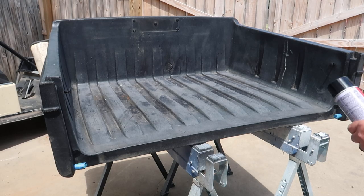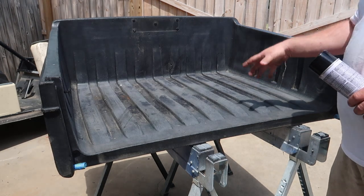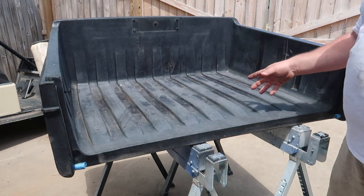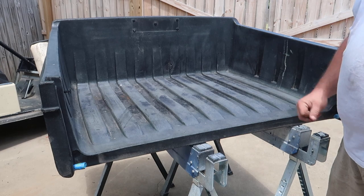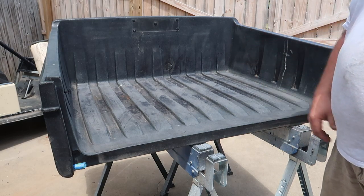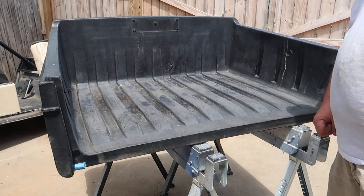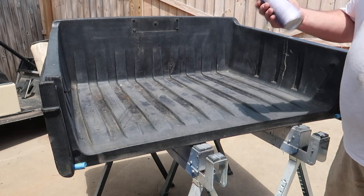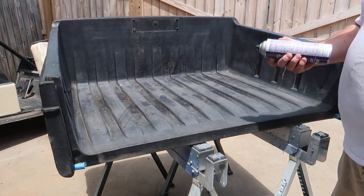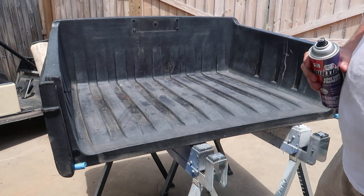So they're calling for rain today in about 3.5-4 hours. We're gonna paint this outside, or Raptor it outside. I've removed the golf cart from the shed and put it in the garage. So after this dries for, let's say, an hour or so, we're gonna drag everything into the shed and leave it for 24 hours. Do the same thing with the tailgate. First thing we need to do is put a good coat of this Bulldog adhesion promoter onto the golf cart.